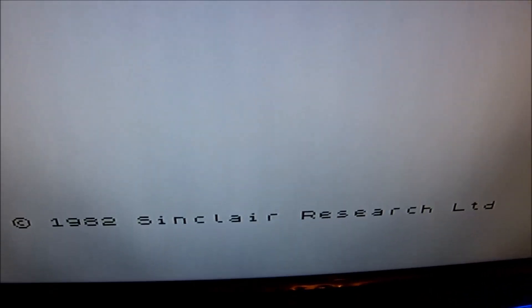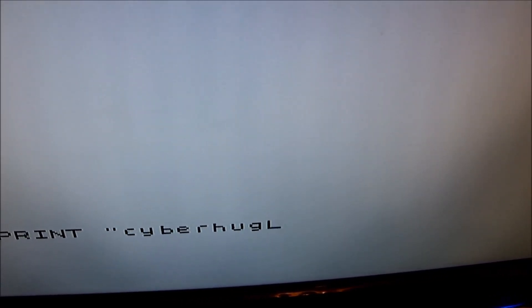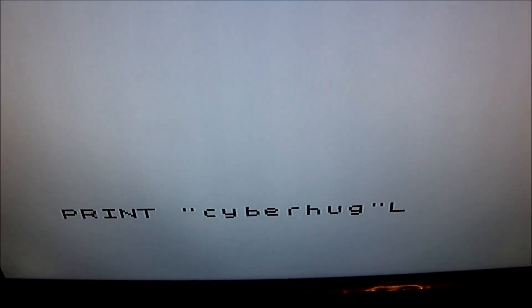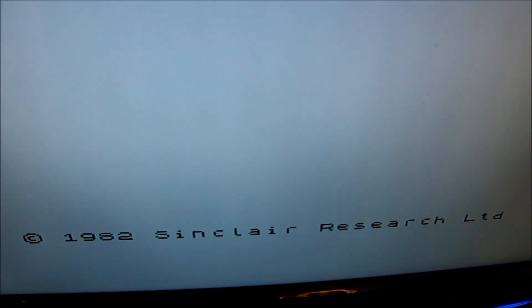The other thing I wanted to mention is that this machine used to have a custom ULA chip. The classic ULA chip for ZX Spectrum has been slightly modified to offer better IRQ and memory management. These improved ULA chips had some additional screen modes: text 32 by 24, graphics 256 by 192, extended color 256 by 192 with two 15 colors at color resolution of 32 by 192, and dual screen — two 256 by 192 pixel screens placed in memory. Quite an improvement.